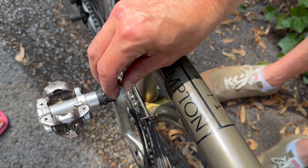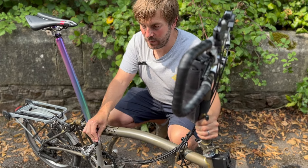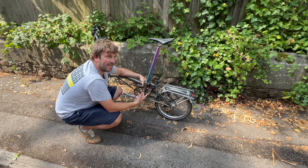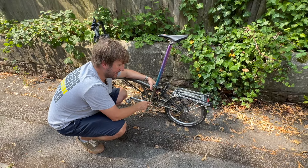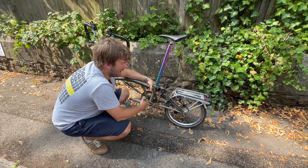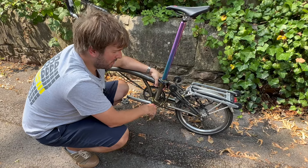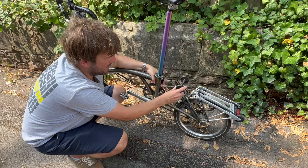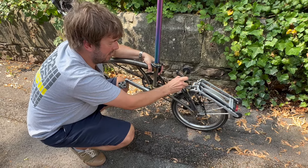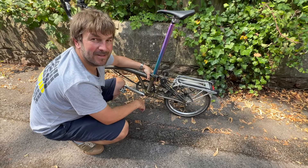Play in the bottom bracket is a good indication of how much the bike has been used. Inside the rear pivot there are bushes — they allow the Brompton to fold. They wear the more you use it and fold it. Mine need replacing — it's about a £40–50 job. It's worth checking because you need to allow that on top. You don't want to ignore it because initially the wear is on the bushes, but if it continues it can wear another part of the frame out. To check it, push the clip, undo it, and move the rear triangle from side to side. That's the rear pivot hinge — really important to check when buying a second-hand Brompton.